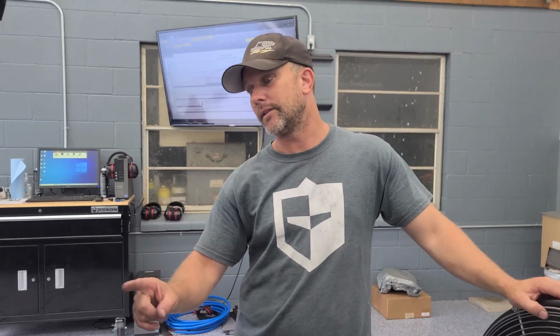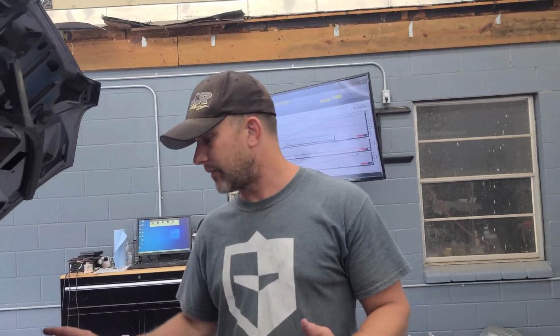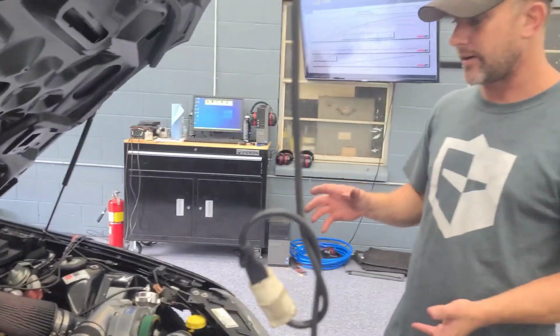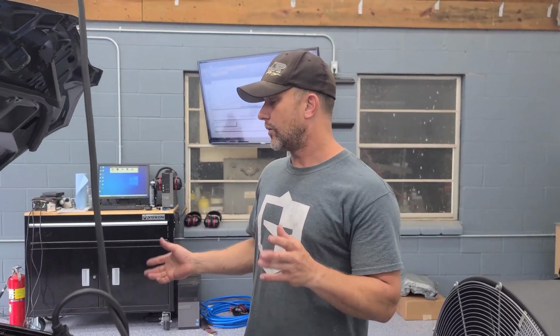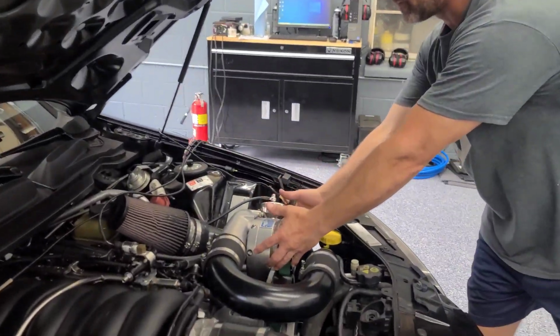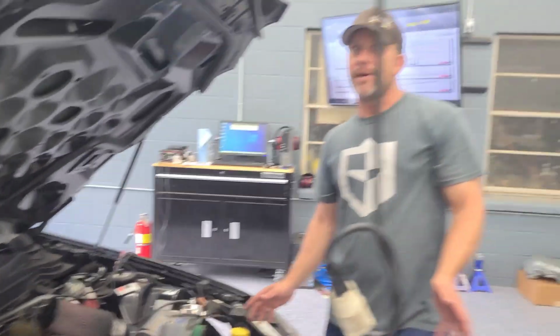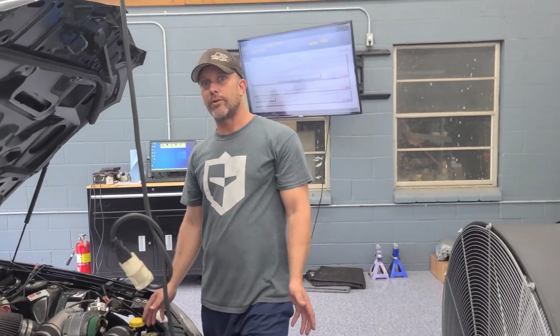The other thing that we do that nobody else is doing, and my car is going to have it, we use this main bracket piece, not all the components, just literally this backbone that the blower bolts to, we use out of the SS bracket, and we modify it so that the power steering pump puller boss, the little guy on the end, will fit through the bracket, because of course the SS is electric power steering, so they don't have it. So what that does is it clocks this blower up and in slightly. I don't know why they don't just have the same bracket for both cars. Because you get the G8 bracket and modify, or no, you get an SS bracket, modified for this.